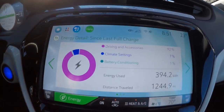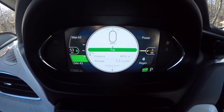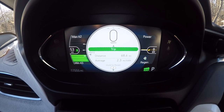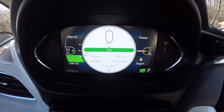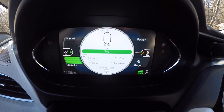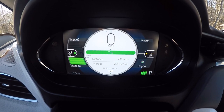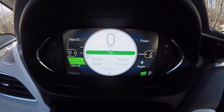The readout is showing me 23 degrees right now. It might warm up a couple of degrees but that's still going to be well below freezing and similar to temperatures we've done in other cold battery charging sessions. We're going to try driving a little bit, getting up to highway speeds quickly and using the regen as much as possible to try to warm that battery up quickly, then see what kind of charge rate we get when we arrive at the charger.